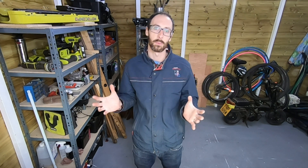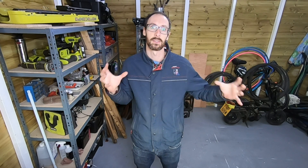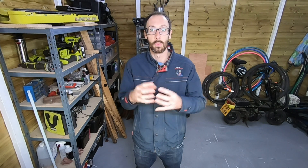Now we've got to think about what we're going to put in there. We have a few options for the electric motor. We can go for a bare motor and use a chain drive or belt drive to the wheel — the advantage being we can fit a much larger motor, though there's more fabrication involved. The newer trend is hub motors. Hub motors are limited by our small wheel size, but the key advantage is they're lighter — the motor actually forms the wheel itself, saving weight and reducing drivetrain complexity. Given that weight, packaging, and fabrication are priorities, we've decided to go down the hub motor route.